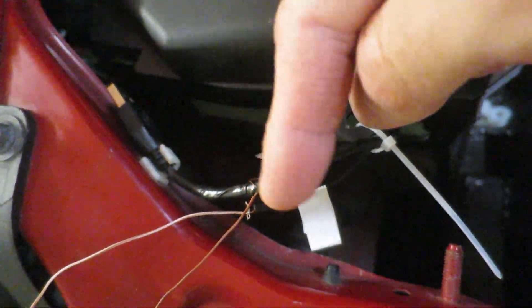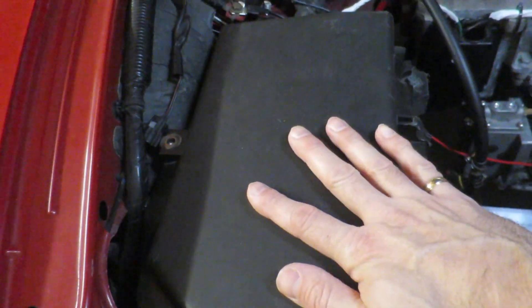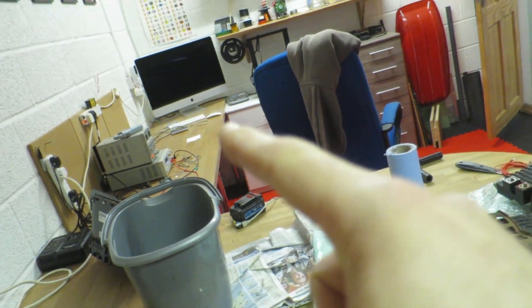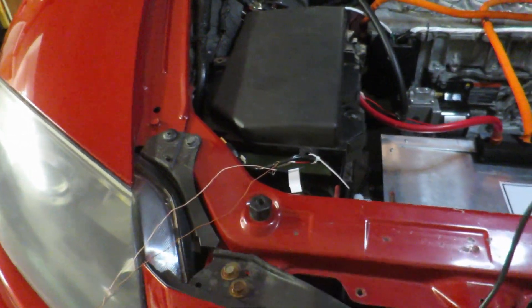Up front, I've also got USB and CAN High and CAN Low accessible outside the box here, which means I can just plug wires in and reprogram my ECU without having to keep undoing and redoing the box. That also means I can diagnose on the bench. My ECU now outputs on its own CAN IDs with loads of diagnostics about the car, which is really cool.